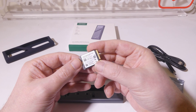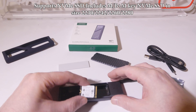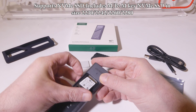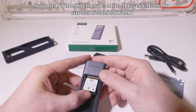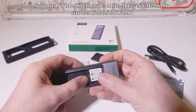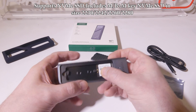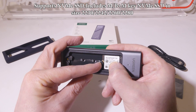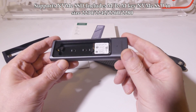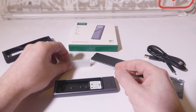Here I have a Western Digital SN740 2230 NVMe drive — this is a two terabyte drive. We're just going to line this up. This particular enclosure will accept B and M key sizes. You'll insert it at a 45-degree angle, and you'll see that we can just use that little grommet there to hold it in place. Now it's ready to be installed with the thermal tape, and then we can screw down the aluminum plate.